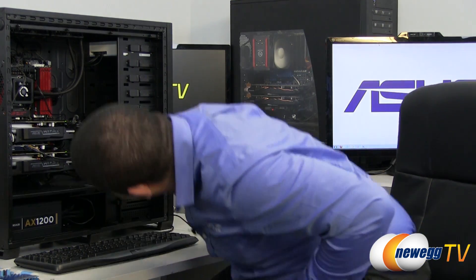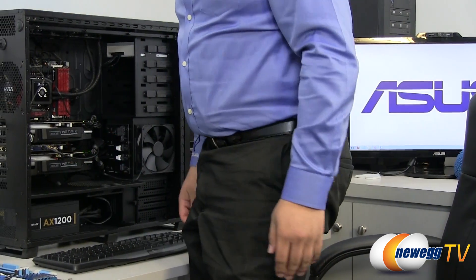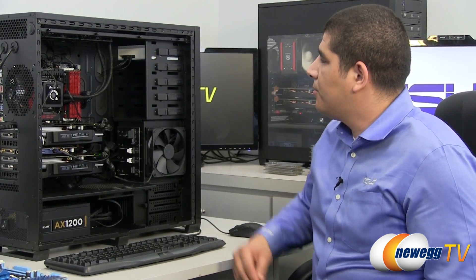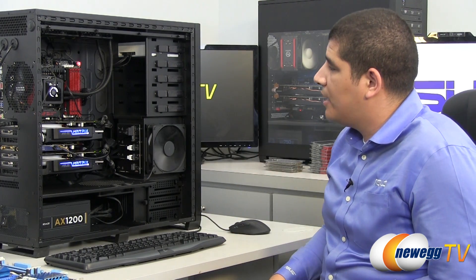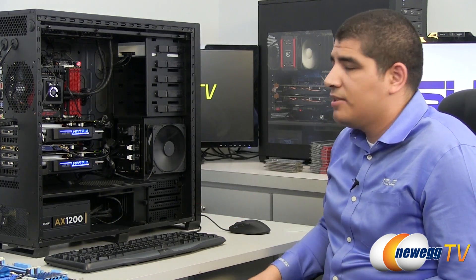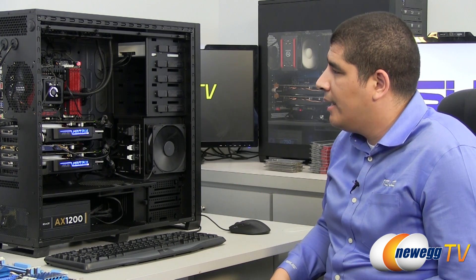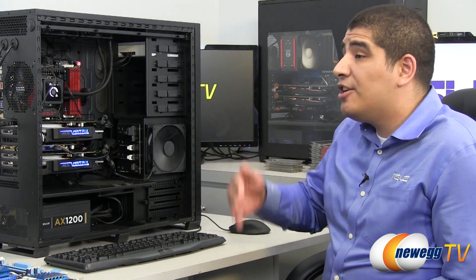We should be wrapping up pretty closely here. Looks like it has stopped blinking — it has stopped blinking. So at this point we're going to say our flash has been completed. We were at BIOS 0403. We're going to go ahead and press our start button, and the system will now attempt to POST. As I said, this is actually a pretty big update, so it's going to go through a couple of changes before completing the actual POST. But as you saw, I didn't have to enter into the BIOS, I didn't have to go into EZ Flash, I didn't have to do any of that.